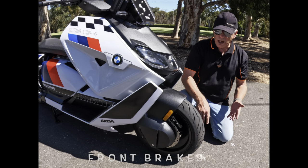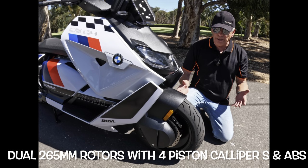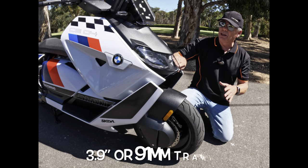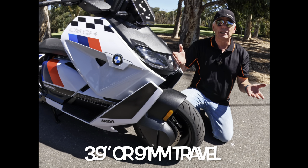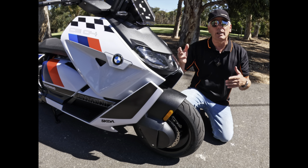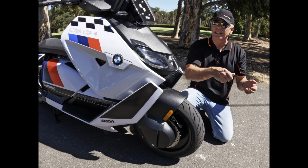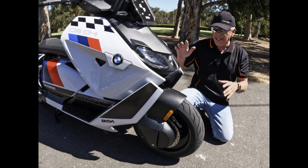Although it weighs 230 kilograms — just over 500 pounds — you're not having to worry about pushing and prodding with your feet. These turns are done absolutely footless: just move the body weight, crank it into the turn, and it rolls around beautifully. Very, very manoeuvrable in tight urban scenarios. Up front, alloy wheels, dual disc brake rotors, BMW calipers — and typical BMW, it stops on a dime. Right-way-up forks tucked away under the fairing. LED lighting, excellent braking, and it also has that follow-me-home feature where the lights stay on for about 30 seconds after you've turned off and walked away.